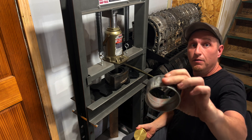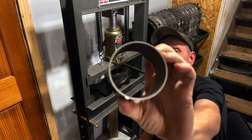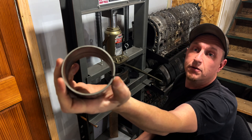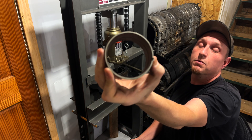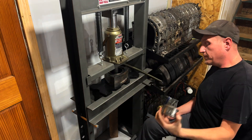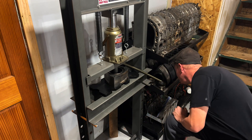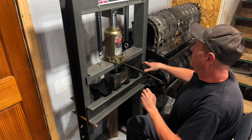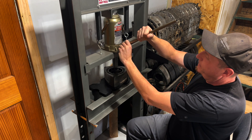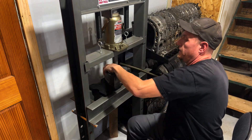Now it's out. As you can see, this bearing was spun — it's got copper in it. And there's the little notch I was talking about on the corner. If you try to press that notch down through the bearing, you're gonna score the rotor all the way down the side, and you don't want that. Bearing's out, trash it. Clean up the inside of the rotor.